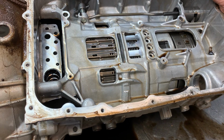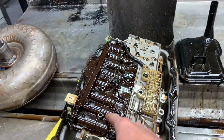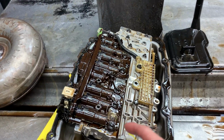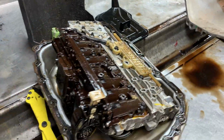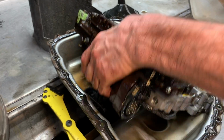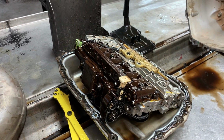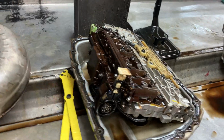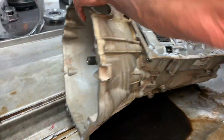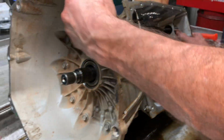And I don't know if you did, I'm thinking you did, just to make sure. This is a TCM. You said ECM. Oh, did I? Yes. I'm sorry. He meant TCM. Yeah, trans control module is right here. But if you don't program it, it won't recognize the ECM and the trans control module and all that stuff. They just won't know each other. Thank you, Trent. No, you're fine. I didn't want to cut you off.